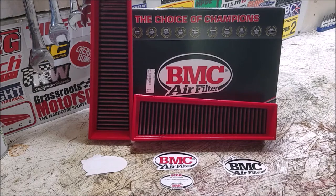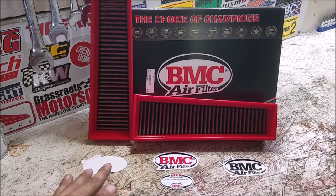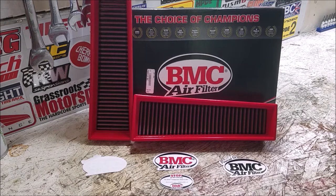Today we're going to be doing one of the most simple yet probably most effective and popular modifications you can do for this car. For about 10 minutes of your time and $100 you're going to replace the air filters. We're also going to be removing the charcoal filter. The combination of going from a factory paper filter and a charcoal filter over to this aftermarket filter should be a pretty big jump — maybe five, maybe 10 horsepower — and we are going to dyno test that.